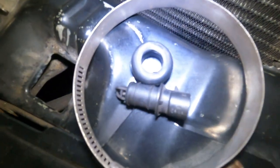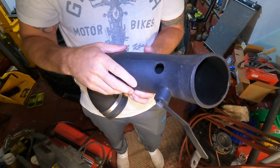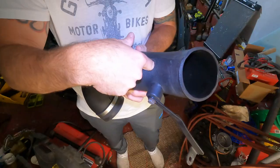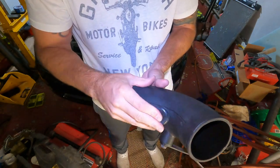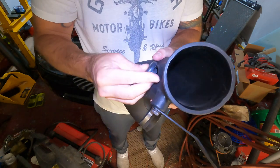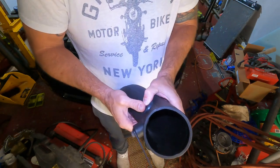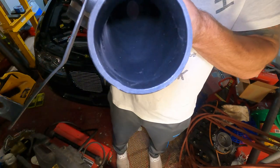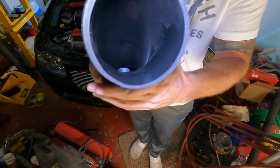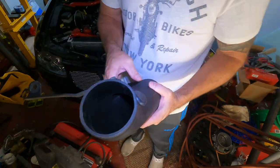I got the temp sensor out along with the O-ring and grommet that belongs in here. So there's our hole. I'm going to see if this little plug fits — I may have to drill it out a little bit, but it actually looks like it's going pretty good. Holy crap, that actually worked! You can see our little grommet cover is in there — that worked perfectly. It's a good start. We're going places — not college, but somewhere.